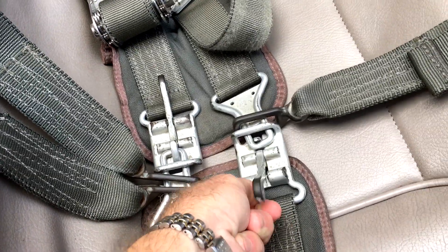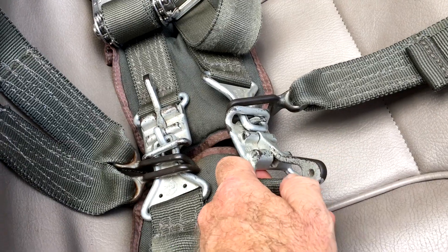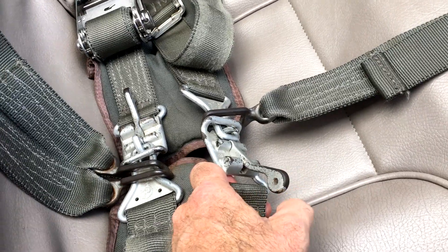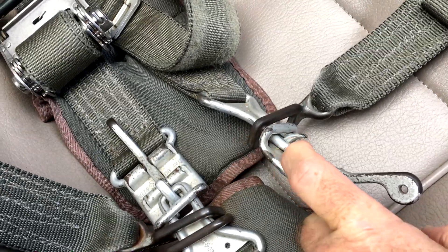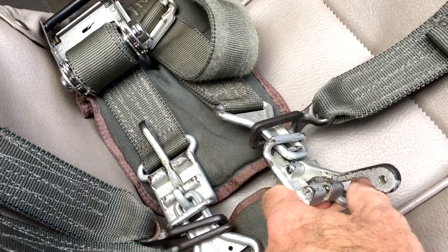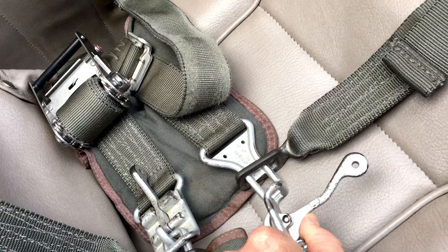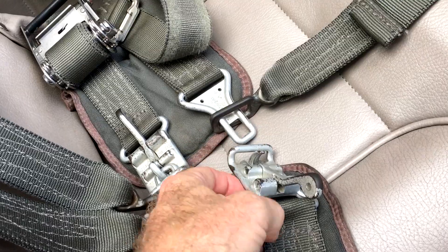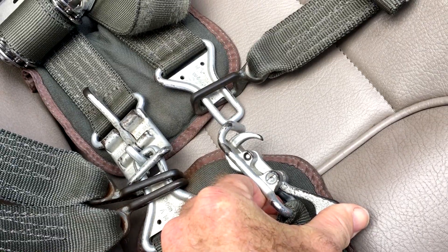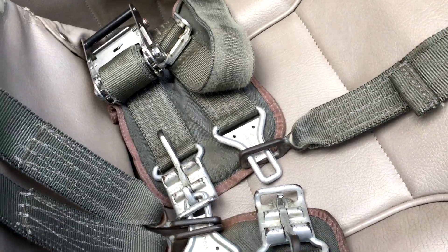To egress, you would simply lift up. The thing to remember is: even if you accidentally lift one of your belts out of the detent, the hook is still captured in the little bayonet going through there, so it's still secure. You have to lift the lever quite a ways — almost completely open — before it releases, and that's another safety feature. Even if slightly open or not completely latched in the detent, you will have security with your seat belt.